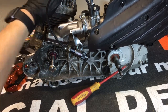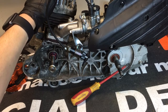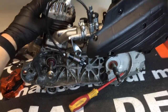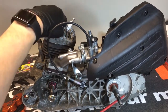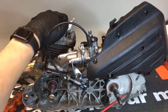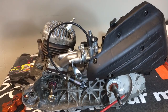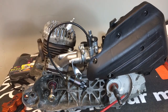Spark plug is a source too. If you run a Trail Tech head temp gauge or another head temp gauge, there's an OEM crush washer that comes on the spark plug. I take those off, put the ring over it, then put the spark plug down — and I'm less likely to get air leaks up here. A loose spark plug, stripped threads, or running both the crush ring and copper ring together is just asking for an air leak up there.